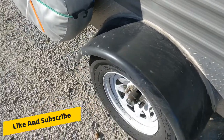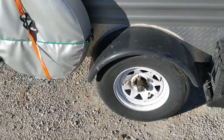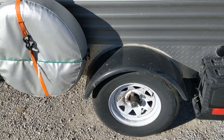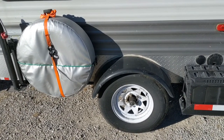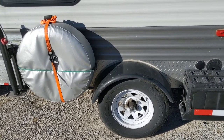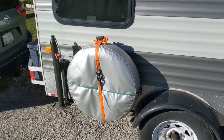And we would hit some bumps and it would kind of rip them loose. So I had to repair them in the parking lot of a Menards one morning and then at a park the next time. So those will have to be reconfigured and brackets made and put down to the main frame. Probably we'll make them out of 16 gauge and then make a flat top so we can put another box on top of them for storage.